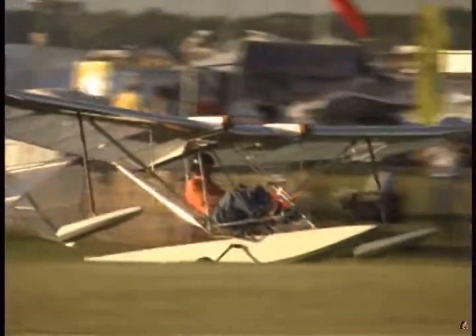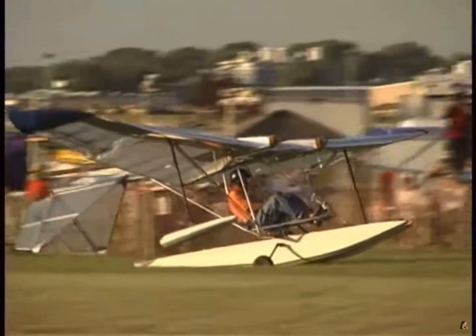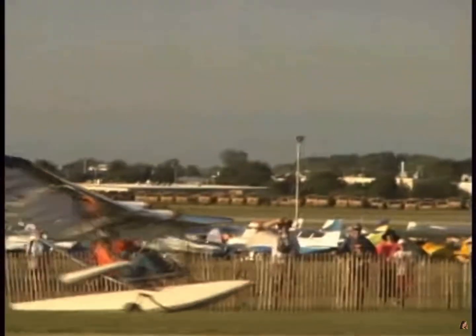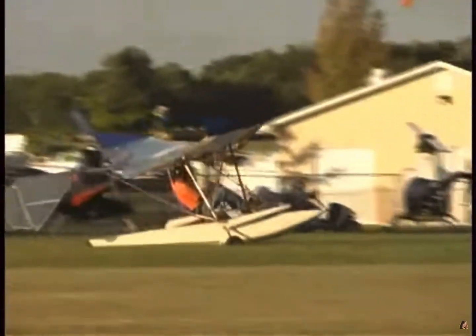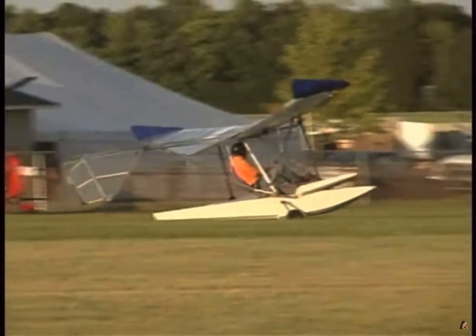Weight is definitely a key factor in any electric airplane. I was counting ounces until I re-read Part 103 and decided that the batteries were the fuel and had to be counted as the five gallons of gasoline. That's how I read Part 103 — it says 254 pounds for the airplane and five gallons of fuel. You also have a 75-pound ballast allowance, and I'm well within that.